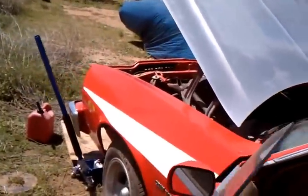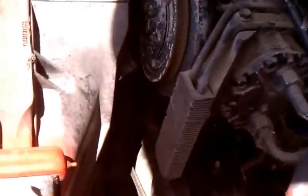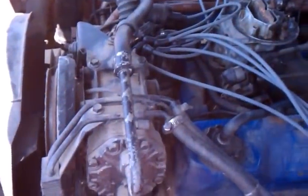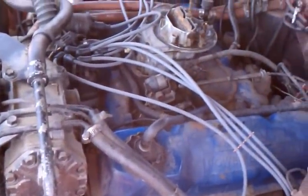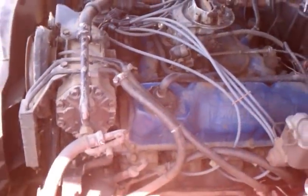The sun visors are removed — I have them stored so they wouldn't get sun damaged. The AC compressor is not frozen. The car does have factory air, though it's disconnected, as everybody did back in the day. The compressor still spins freely — probably just needs an evacuation and recharge, if you could even get R12 anymore. Overall, for the price I'm asking, this car's got a lot of potential.